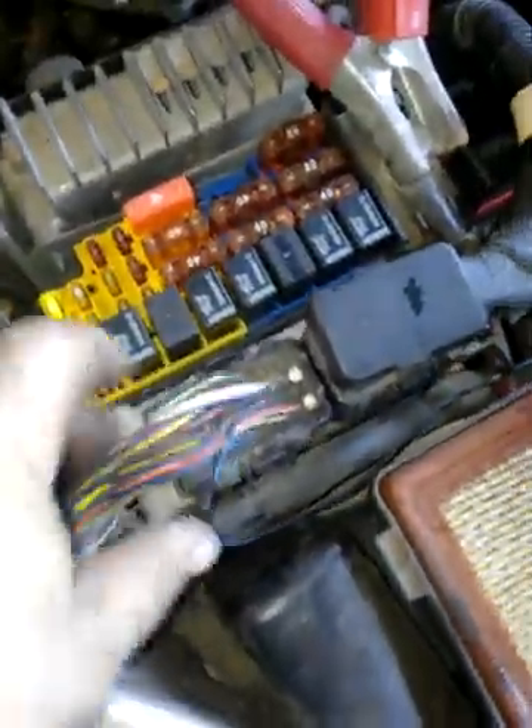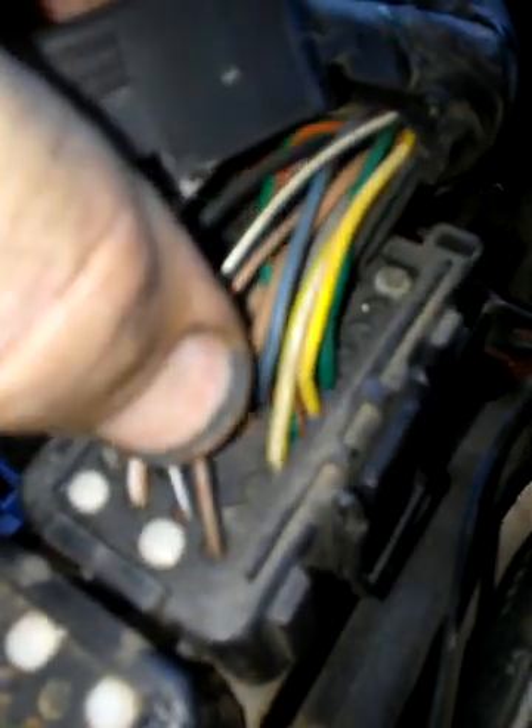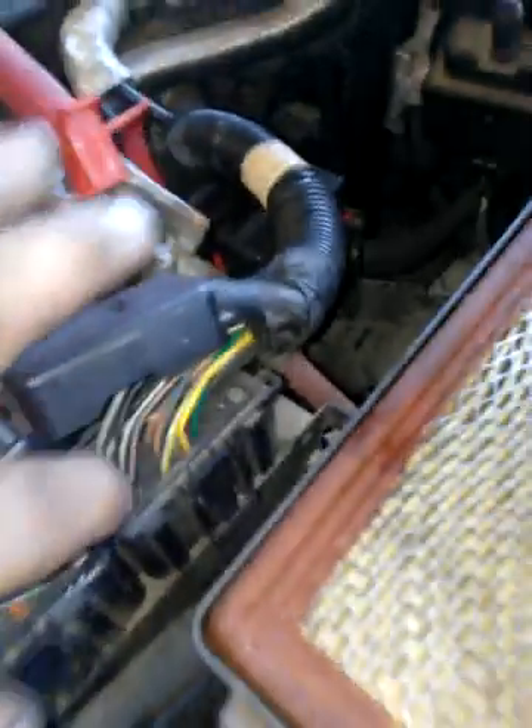That's a quick troubleshoot for you on this particular model. Sometimes the ground wire will break. Always check your ECM connections. As you see, this car — I picked it up for $200 — it's got a little bit of drama where somebody's gotten in here and pulled on some stuff. See this wire down here — it's broken right at the base where it goes in. That can be a problem. Sometimes the wires will break inside the insulation — this one's got a kink in it, so watch for that. Also a common problem on these cars — as you can see, somebody had a problem with the oxygen sensors. What they did was splice into the original wiring and eliminated that wire from the harness and ran their own, which is really tacky. That'll also set a check engine light which will constantly flag the oxygen sensors — you'll put in five or six of them and it'll keep saying the same thing. Fortunately, somebody's already done this for me so it shouldn't be too big of a deal.